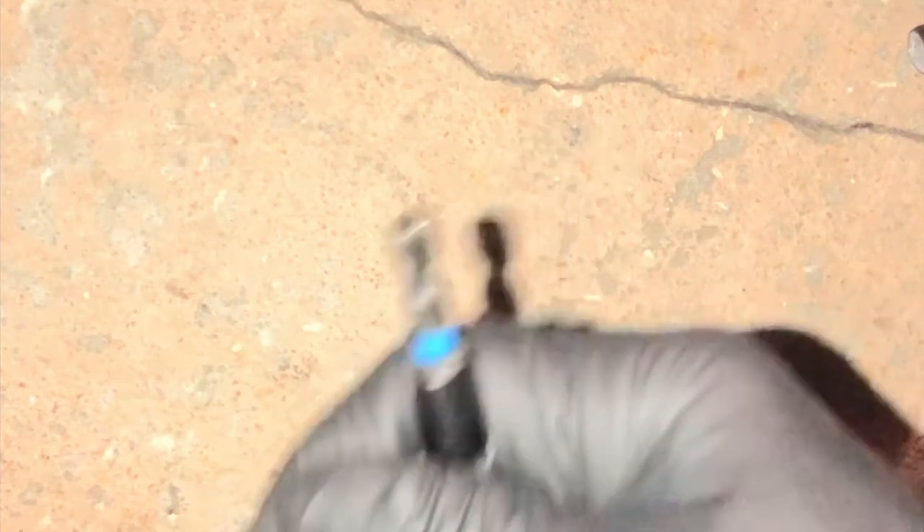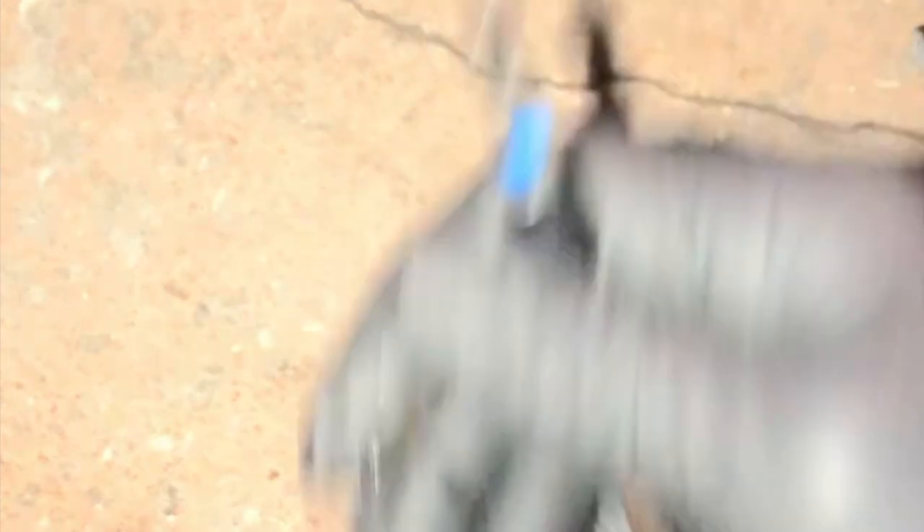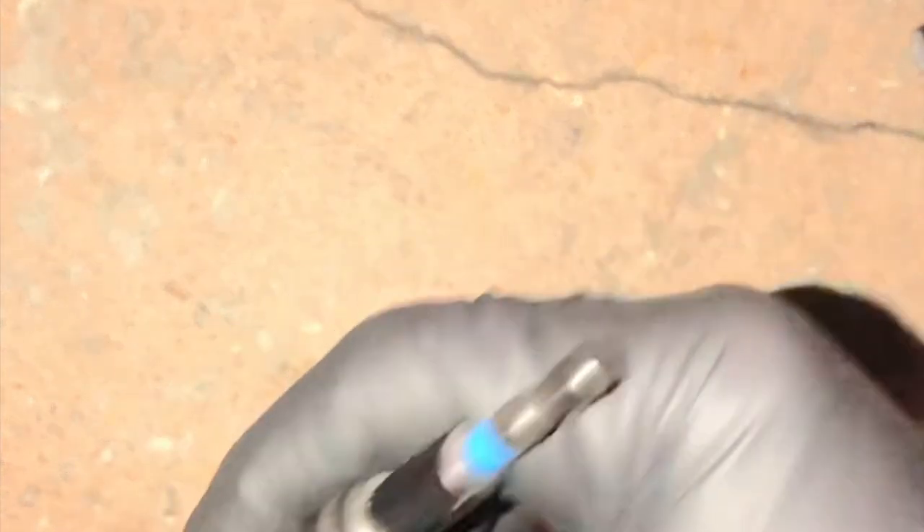We have the auger motor. We just tried getting ice and you can hear the motor not turning. You can feel it — it's actually cold — and you can see all this rust. These things freeze up over time and get just full of ice. Those two tiny holes are vent holes.